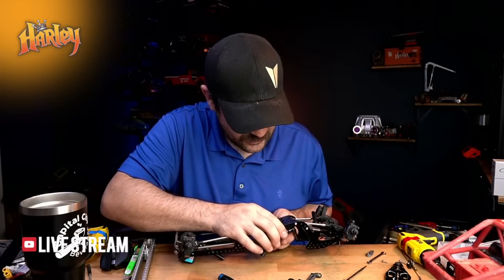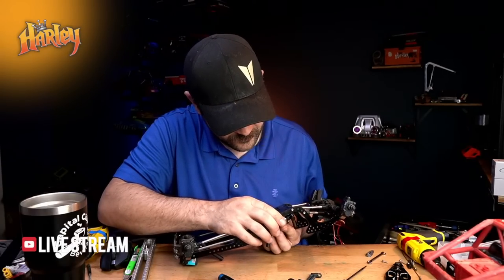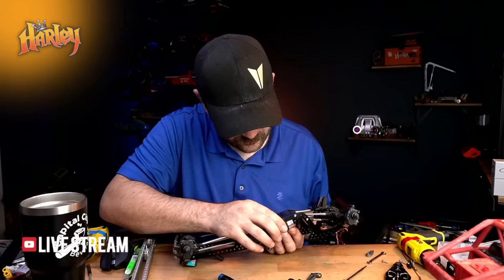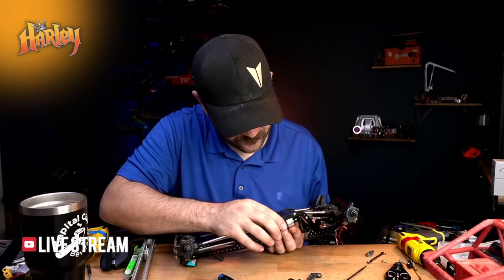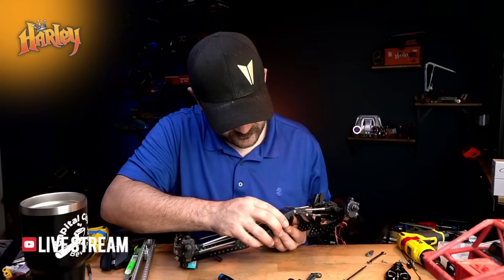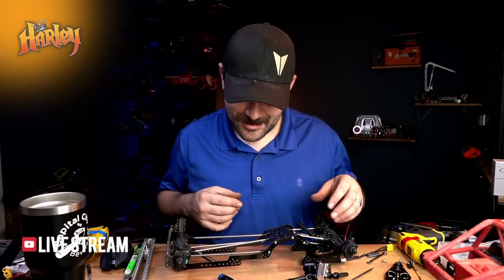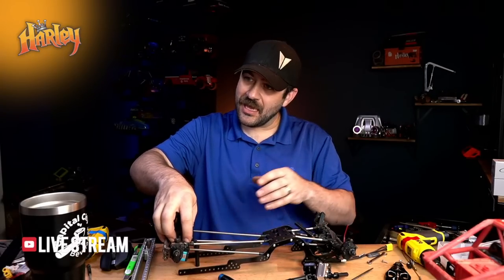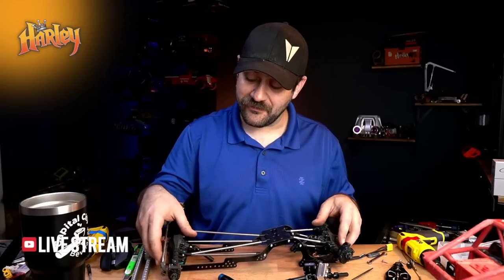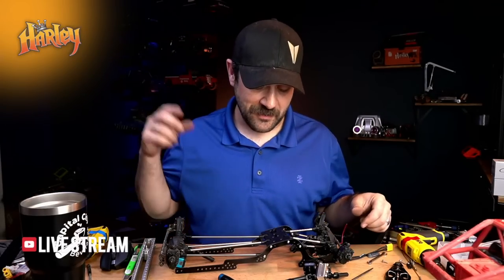Where is... So I can angle this trans a little bit, which I believe is how it is in my deluxe asylum, but just swap the links on one side only. If I bend the uppers and put them on the outside of the chassis, it may work. The other problem is that these are titanium links and are very difficult to bend in here with just, like, a couple of box end wrenches at best if I wasn't going to use my bender out there.